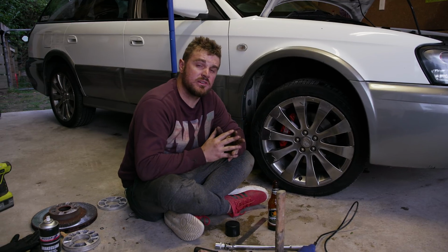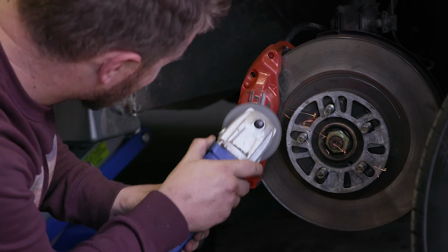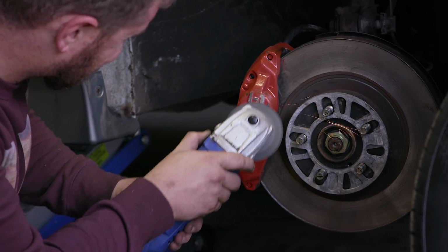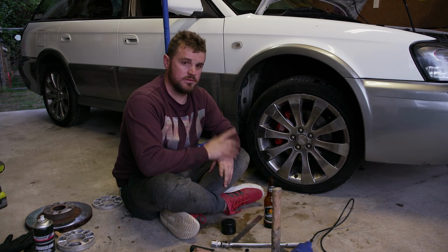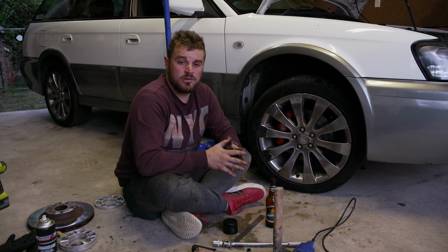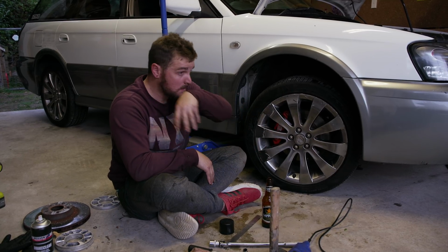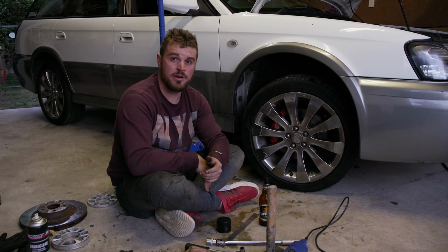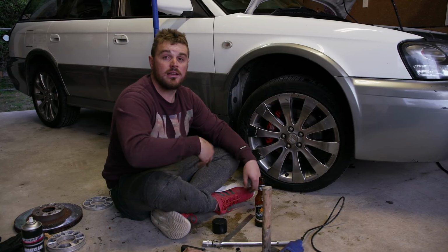Alright, so we're gonna have to finish the episode there because I can't get these wheels to fit over the brakes. I've already shaved down the line on the Subaru logo, and it just won't fit. Like I said, all Subaru parts fit on every Subaru, except for these fucking wheels, which don't fit on these brakes. So, what I'll do is I'll head down the shop, I'll buy some spacers temporarily. We're gonna have to fuck these wheels off, get a new set of wheels. I'll probably aim for a set of WRX wheels or RX wheels, something like that, 17s rather than these 18s.